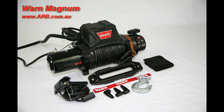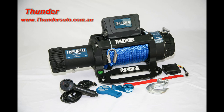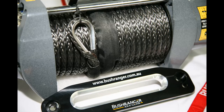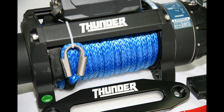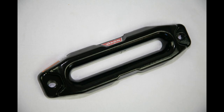We've assembled seven of the best electric winches available off the shelves in Australia for a no-holds-bar tug-of-war. We asked each supplier for nine-and-a-half thousand pound winches with synthetic rope. There's a huge variation in motor horsepower ratings, final ratios, current draws, and the supplied accessories.